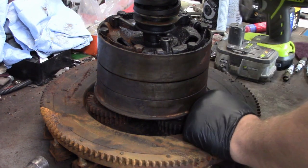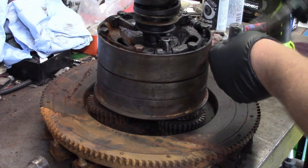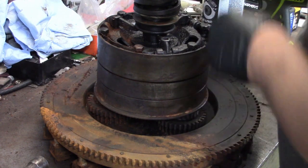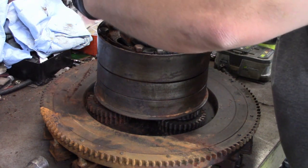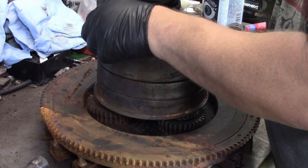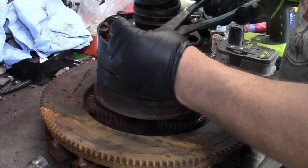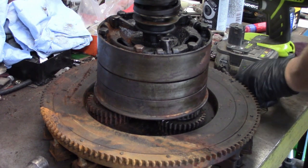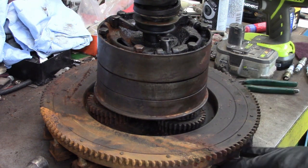I've never taken one apart before, but I did educate myself a little bit on it. So first we're going to get rid of the safety wire on these bolts. It is good and grimy and oily. That's a good thing, especially when it had a little water in here. All right, so we'll get this safety wire pulled out of here. Hopefully you can see what I'm doing there. Safety wired in pairs, like that. We try to keep track of all these little pieces of safety wire. Even though everything is going to get cleaned and thoroughly inspected, you just don't need these extra little pieces hanging out in the transmission, especially the one that you're going to use the magnets on.